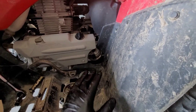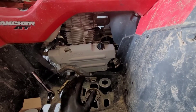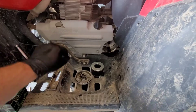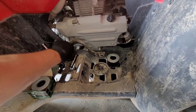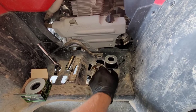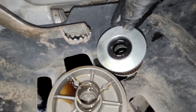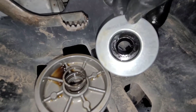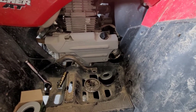The point of this video is the oil change I'm doing right now. I just dropped the oil and taken the filter housing apart. On the Rancher 420s and the Rincon 650s and 680s, the oil filter housing and whole assembly are identical, so I use the same filters. I've got the spring out and the oil bypass bolt that holds the cover on taken out — but we're missing something. On the filter there is supposed to be a steel washer, and that washer prevents the spring from eating into the rubber and degrading it. You can see the little depression on the rubber O-ring on the filter where the spring has been pushing into it.